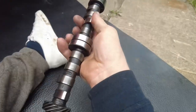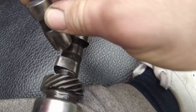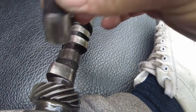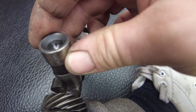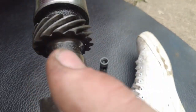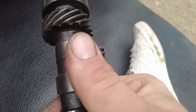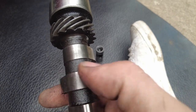Here's the old camshaft. As you're set for TDC, what you want to see is the cam lobe and here's a lifter that sits on top. Obviously with it inside the engine, as it rotates it comes to the back of the camshaft where, if you actually look, there isn't any lobe — it's just flat. On every single cylinder you set your valve clearance at this point because this is the lowest point of each lobe.